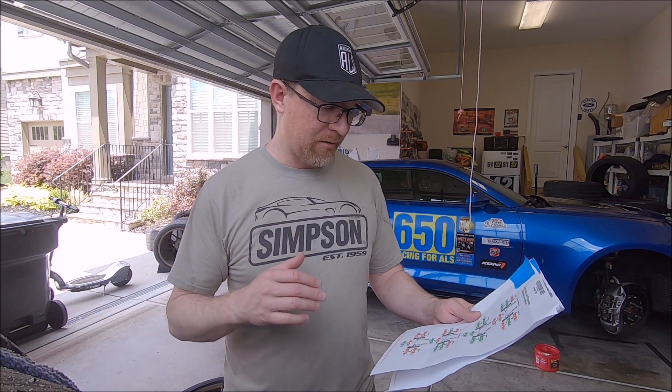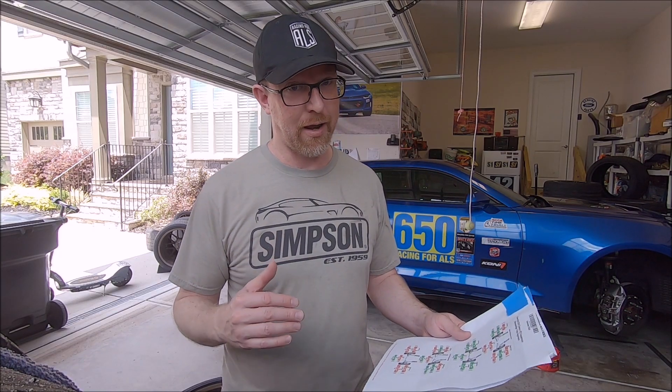And then I've gone to negative 2.0 rear camber. That's resulted in better tire wear and more grip, and it's shifted the balance a little bit. Going to more negative camber in the rear caused a little bit of understeer, and I've compensated with that by both manipulating the shock settings and also running one PSI higher than I typically did in the rear. And it's balanced the car out — I really liked it on track, better tire wear.